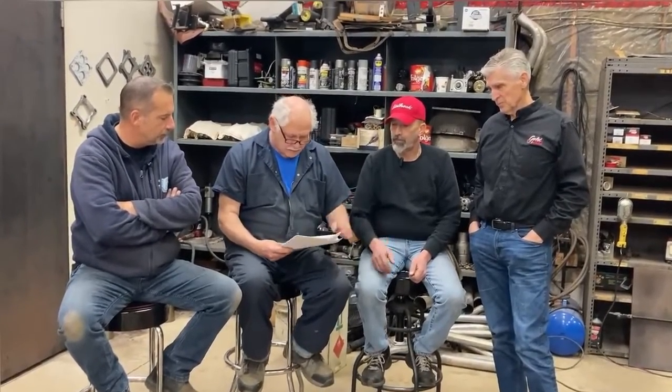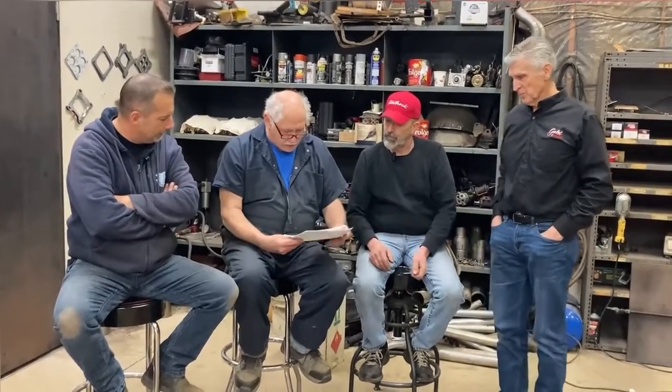So we took the carburetor back apart, and we noticed that it still wasn't using enough fuel in the back. So we went up 2 jet sizes in the back to a 98 rear jet, and that's a huge hole. We made a pull at that. We went up to 7,500 too. We ended up with 929 horse at 7,300 and 644 foot-pounds of torque at 5,700.